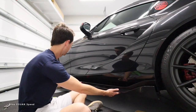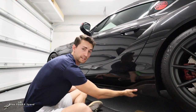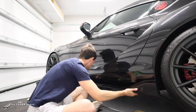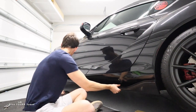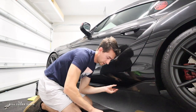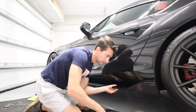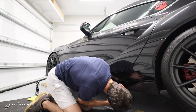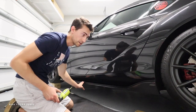Let this hang a little bit, peel off the rest of the tape, and now you want to really line it up against the plastic side skirt and make sure the contours match from the carbon fiber to the plastic — a nice tight, secure fit. Hold it tightly as you make another hole. Luckily the tape makes it a lot easier to hold everything securely. Once I get these two in, we should be secure enough. Then I'll go underneath and finish up all those holes.